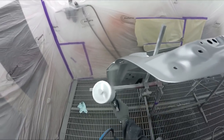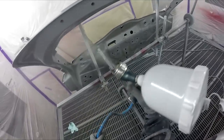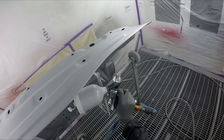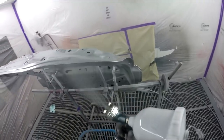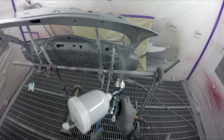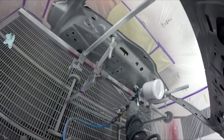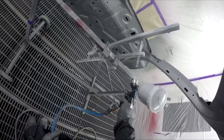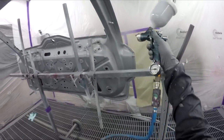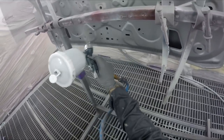Once I've got the base coat down I'll crank it up to maybe 30 or 34 just to get that base coat drying a little bit quicker. If this stuff starts drying as you're spraying you'll make an absolute mess and it'll go on motley. I've found you're actually best off spraying both coats on the outside - your first coat and your second coat on the outside - and then coming in and doing the inside of the tailgate. I've tried a few different methods with this system on new parts and I've found that this way works the best.